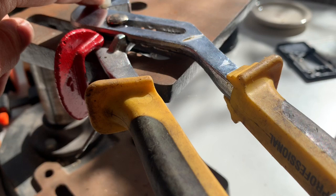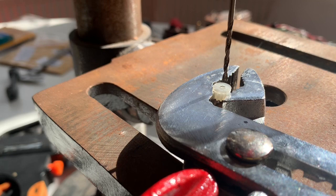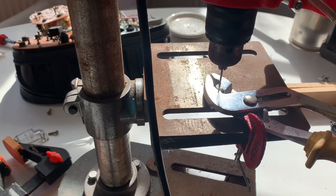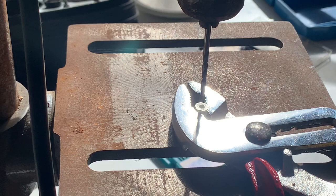I've got a set of grips that already have teeth in them so the cog won't spin around. I've just tensioned them with an elastic band — I don't want to squeeze too hard and risk damaging that cog. I've clamped these solidly and I'm going to start off with a two mil drill, then step it up to two and a half, and then try it with a three mil, hopefully without damaging it. Okay, that's two and a half mil done. Now this is the three mil drill — it'll either disintegrate when we try to drill a bigger hole in it, or it'll work.